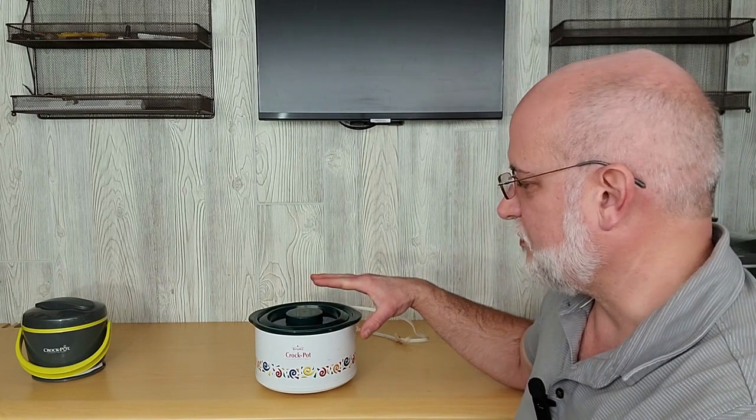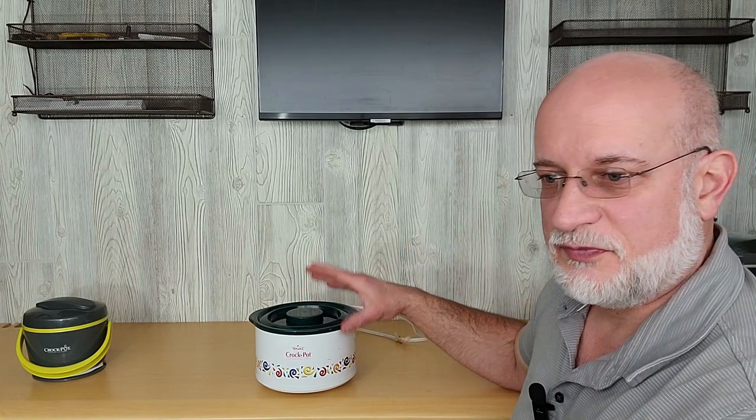This was the second crock pot I used — it's a one-quart crock pot. The label on the bottom says it uses 47 watts, but during my test it measured 41 watts. So it's bigger than the first one but actually used less power. The highest temperature this got was 150 to 158 degrees, and it took an hour and a half to get there. For both the first and second hour it used 40 watt-hours. Both of these small units would cost less than one cent per hour to run in my house.